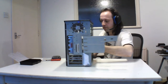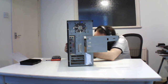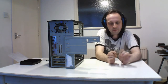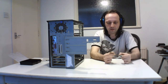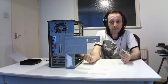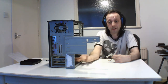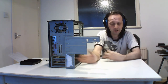Let's pop this off. Like I say, I'm stripping everything out, including all bits and pieces to clean it. So this is the little, most manufacturers have universal, but this is just a power switch and 2 green LEDs and a proprietary connector which just fits straight on. So you cannot use this in another case because you would have to take this with you, and you would even have to guess which pin does the power or LED. So OEM cases you cannot put them into other cases or reuse the same case without modifications because they were designed to fit that hardware.